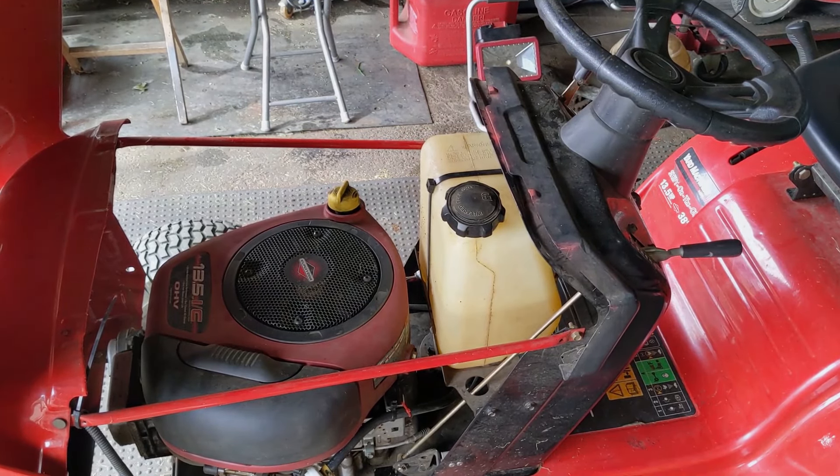We don't really want to push all of that debris through, so one of the best things I can do — because I have an ultrasonic cleaner — is to just toss these into the ultrasonic cleaner and it completely blasts away all of the gunk. I know a lot of you don't have one of those, so what you can do is simply put this into your kitchen sink or a bucket of hot water and some soap and allow all of that fine debris inside of the vent to soften up — a lot of times you can clean them out that way.